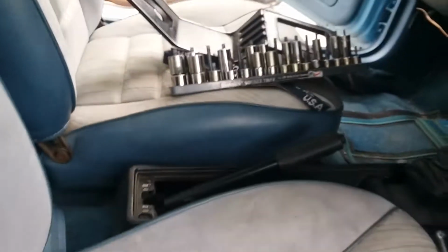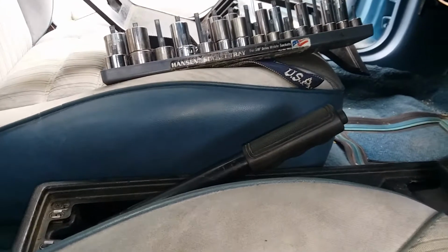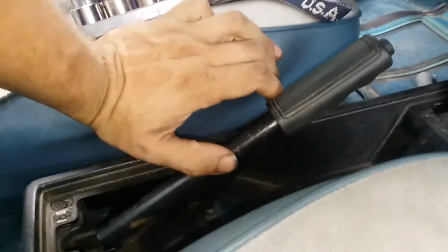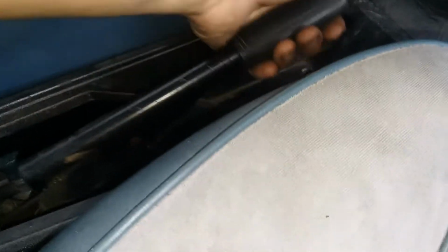I like having it so that my handbrake is set about 2/3 to 3/4 of the full travel. Remember, I said that mine wouldn't engage until it was at its topmost tooth. Well, now it's engaging a little early for my liking. I want it to be above the seat so I can see it. I also don't want it dragging when it's on the bottom, so I'll loosen it up some.